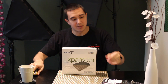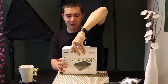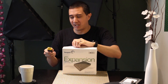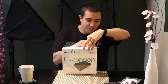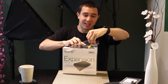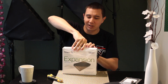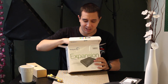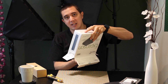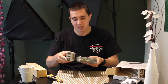Typically, they don't advertise any specifications. If you're going for 3.5 inch internal OEM drives, there are tons of specifications — like green, red, black from Western Digital, 5900 RPM, all that kind of business. Quite frankly, if you're running a desktop, the necessity to have a 3.5 inch drive of a specific spec is very low these days. If you're going to be working with the data, or it's on your operating system, just get an SSD. Stick to SSDs for any work, or where games are installed. Even if you do video, I don't really understand doing anything other than just getting enough SSD. The sizes are getting considerable now — for $200, you can get yourself top-of-the-line SSDs.